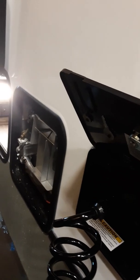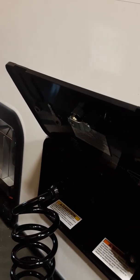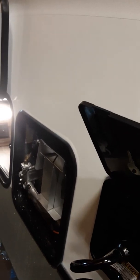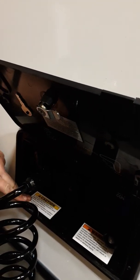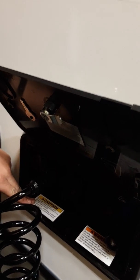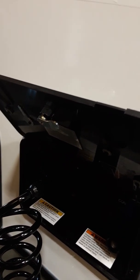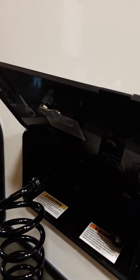So at Coldbrook, I probably won't need the freshwater tank. No, if you're hooked up to water, you won't need the fresh water tank. But when I'm off grid, then I would have to fill up the freshwater tank first, and then I need to eventually dump out the black water. The black water, yeah. This is in case you want to clean out your black water. If your tank's not reading, sometimes toilet paper gets stuck on the sensors, so you don't know if your black tank's full or not. So you just hook up water right there, and it'll flush out the whole entire black tank.